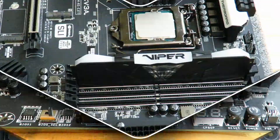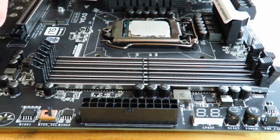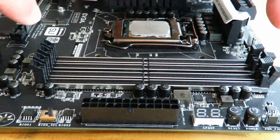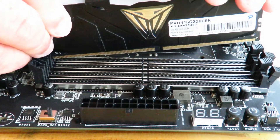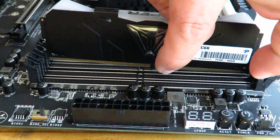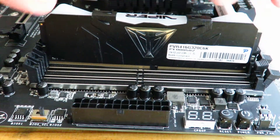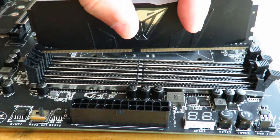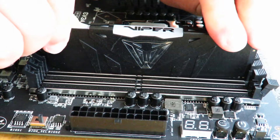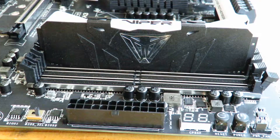About the notches lining up — you slide in the memory on the side here. If you have the type that doesn't open, you just slide it in; if you have the type with clips on both sides, you open both sides first. You can see here: if I slide it in incorrectly, the notch on the RAM is here but on the motherboard it's offset — so it seesaws. Now we just turn it around, slide it in place, push it down, and you see that lock engage.